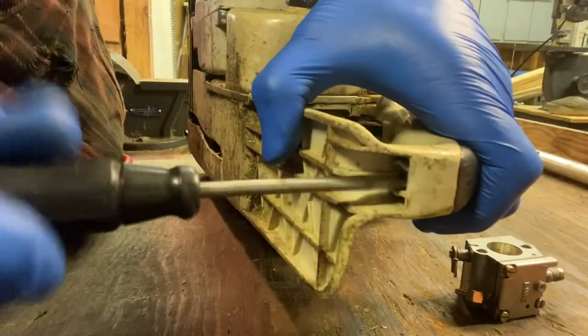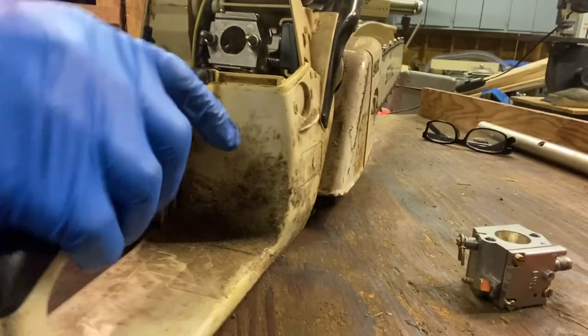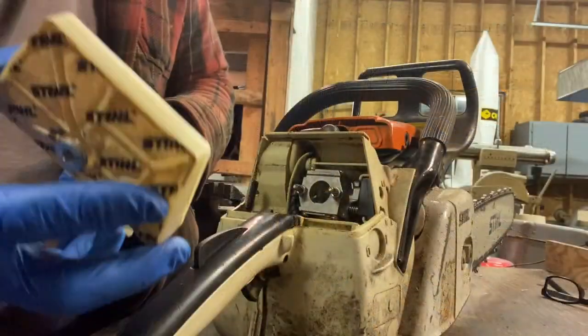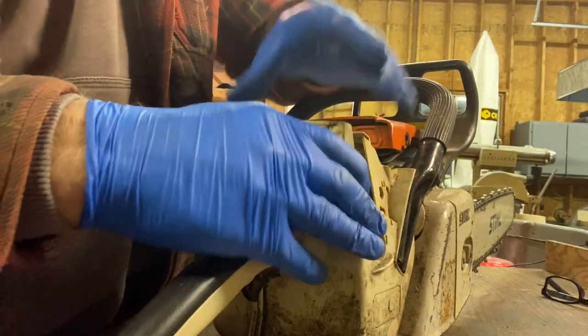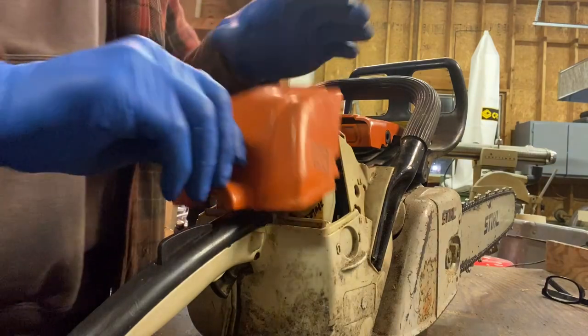Then go get your handle and put it down. Make sure everything's working and nothing's caught. Now we put the air filter back on and put the cover back on. Before you change the carburetor out, make sure that you dump the fuel and change your fuel filter — I've already done that. So all I'm going to do is fuel it up and see if we can get it running. Make sure you do that because it's super important — brand new carburetor and next thing you know you gum it all up again. It's really important to put in fresh fuel and a new fuel filter.